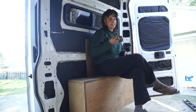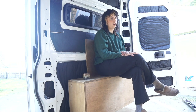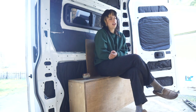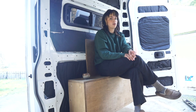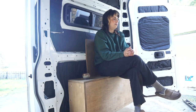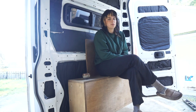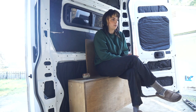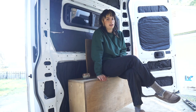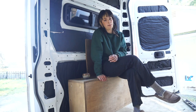It makes a nice little seating area right now while there's nothing else in the van. Well, that concludes this project. It was overall pretty easy to install, but getting all of the materials and cutting everything I definitely had a hard time with — I think it was mainly my mental space though. It looks way better than I thought it was going to. With the jigsaw, the cuts are definitely rougher than they would be with a circular saw or table saw, but it ended up turning out really well. I'm happier with the second stain, and the rivnut tool and the Kreg Jig are both essential items to have for your van build — if you're on the fence about getting either of them I really recommend both.